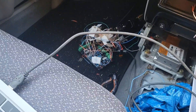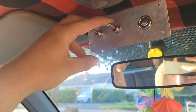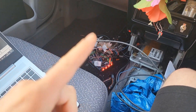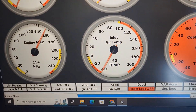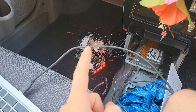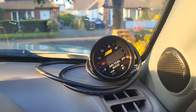We've got power to the car and now if I flick the ignition on, the ECU should come on and so should the AFR gauge. I heard the fuel pump prime so I definitely did something right. The temperature readings do not look right — it's 20 degrees outside so we need to calibrate those. However nothing has caught on fire yet, so that's good. I also — wasn't even looking at that but the AFR gauge is working, look at that.